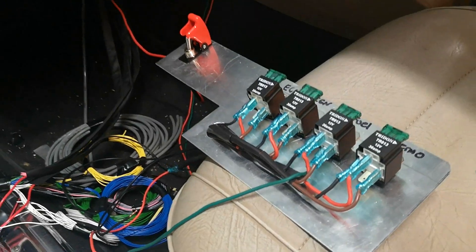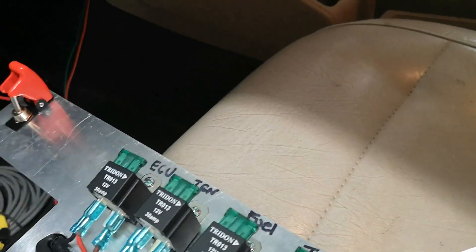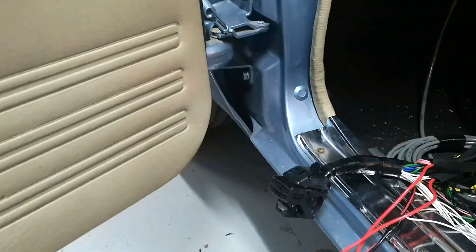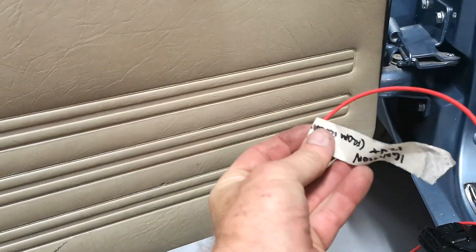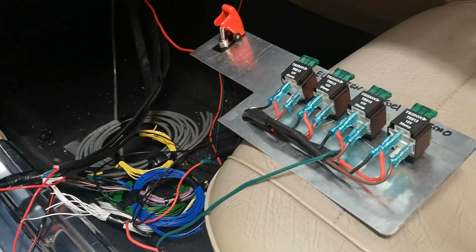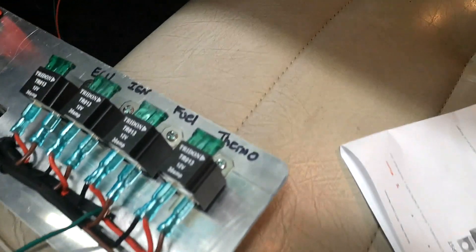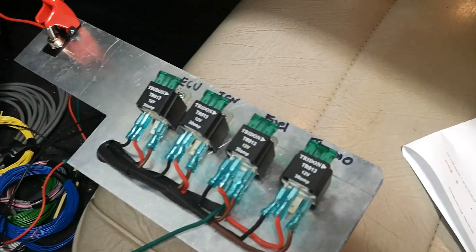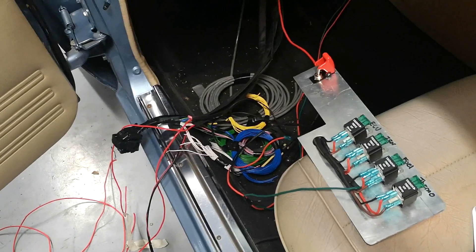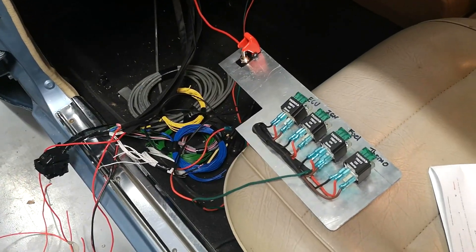Not all of the black wires are common from the wiring diagram — some of them go to specific places, so I haven't made them all common at this stage. I need to do a bit more research on that. When it fits up inside the glove box, I've got ECU and ignition theoretically. If I take these couple of wires — this one is to ECU, this one must be to ignition — and hook those up, the computer should fire up by rights. The only one I haven't really looked at yet is the thermos because I'm not sure where I'm going with that — I've taken the radiator out now because it will foul with the inlet pipe.